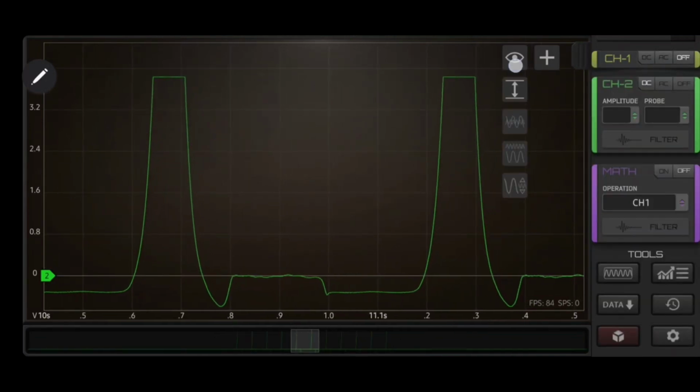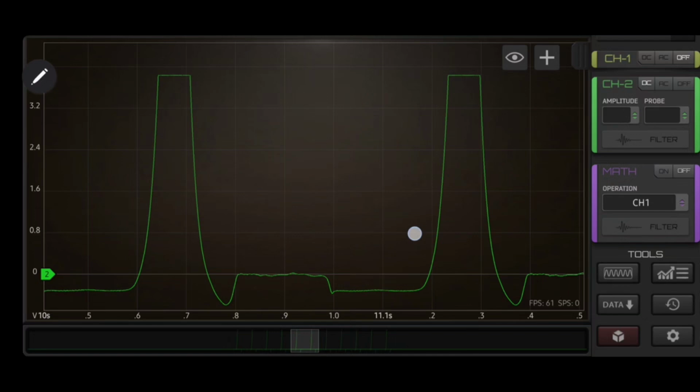Okay, so now with that being said, yet again on our cranking, we want to see at minimum 100 psi. It takes 100 psi of compression in order for fuel to vaporize properly, in order for the ignition cycle to happen properly. I'm not saying at 97 psi the vehicle isn't going to start, but in order for it to be proper, it needs to be as close to 100 as possible. Obviously it should be over 100.